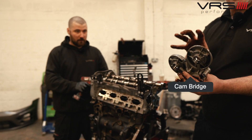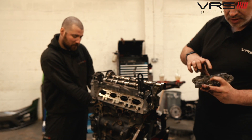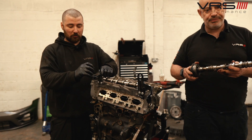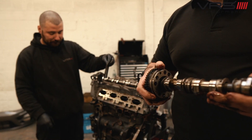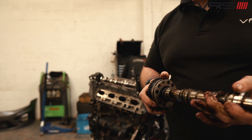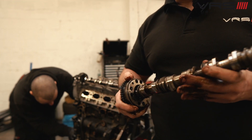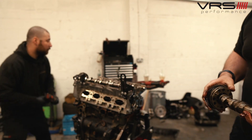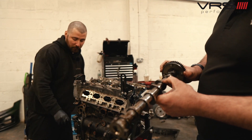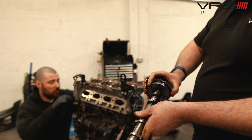This is what keeps the cams together at the top, and that enables the oil to come up from the engine — comes through here and up into where the valves are. Here's your cam — it's your exhaust cam. You've got two lobes for each valve: the normal low lift lobe and a high lift with more duration as well. The cam switches from one lobe to the other at a certain point; that's all done by the engine ECU calibration. The inlet cam is just normal with one single lobe, but you'd still have your variator on the end which swings the timing.